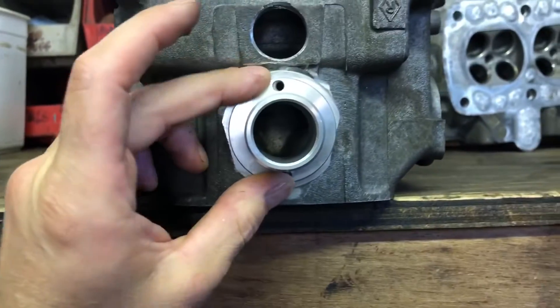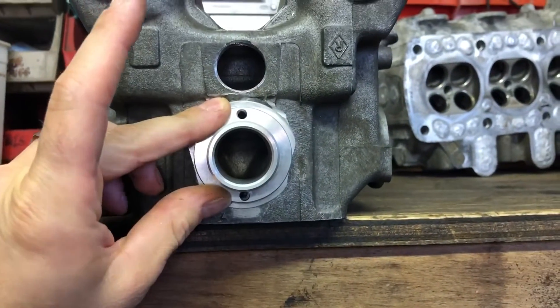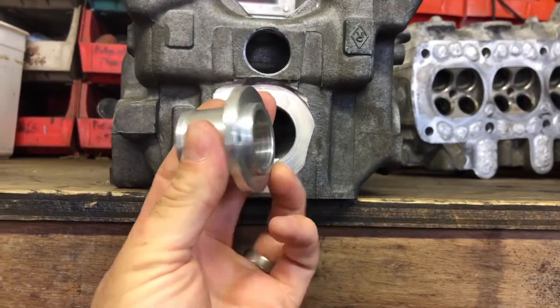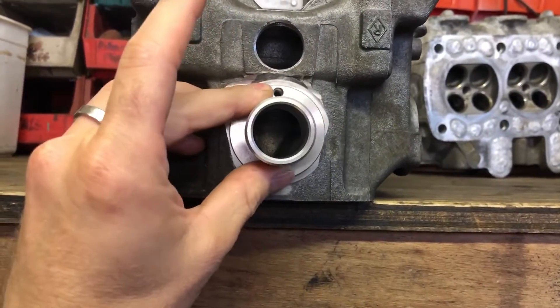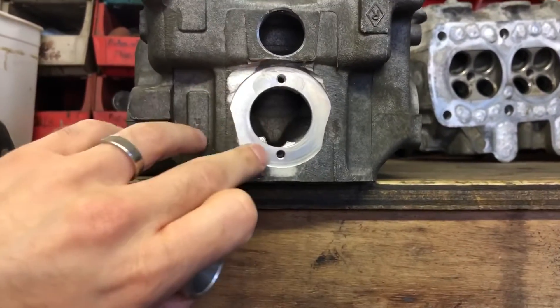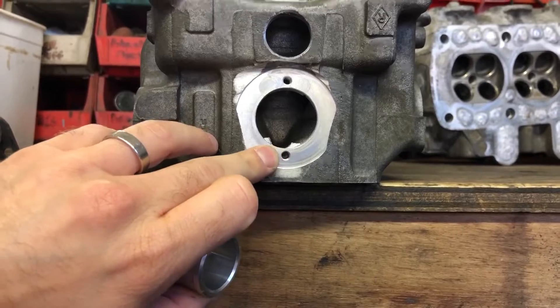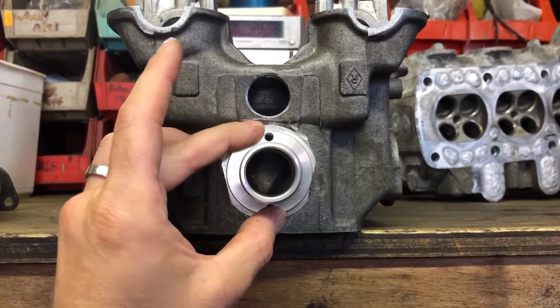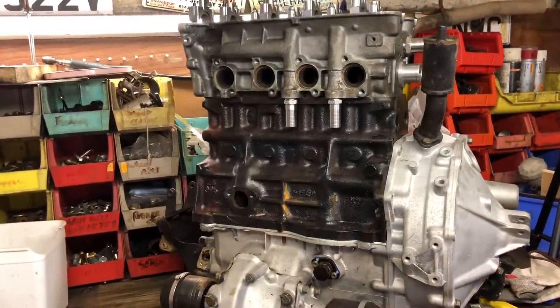Because I'm running a dry deck, I've got this waterway fitting on here. I'm going to put a little rubber ring around here for sealing and I'll probably RTV it as well, just for good measure, because I don't want water coming out of these two securing holes.